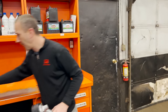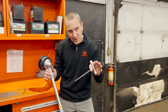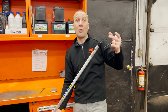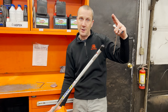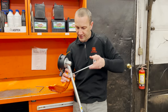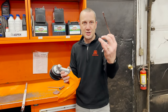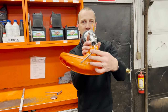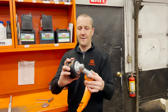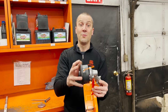We have this little trick that we've created here at Carl's. This might be a little bit harder for you to recreate at home. There's a couple ways you can fix this — one is to come see your dealer and pay them some money to do it. The other would be if this was a full trimmer, you could pull the motor off and hold the shaft at the top with a pair of vice grips. What we've done here — we've made this funky little tool. So let's take the gearbox off just like so. We have an old trimmer shaft that I've bent into an L, and I'm going to drop it in the gearbox like so. And I can now act as a lock. I'm going to hold that tight and spin it clockwise to take off the head. Problem solved.